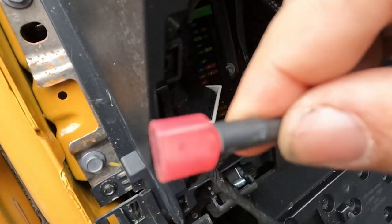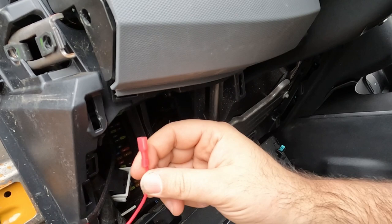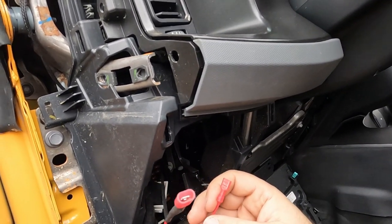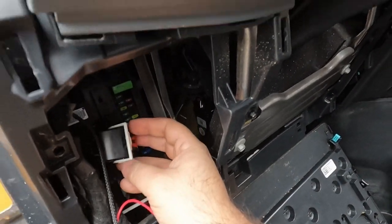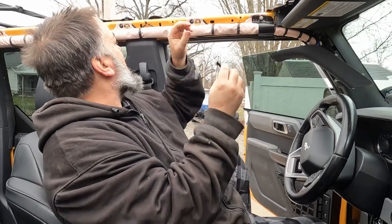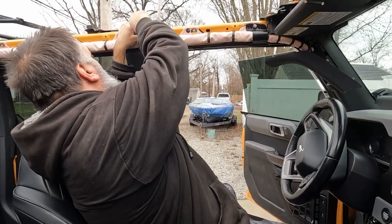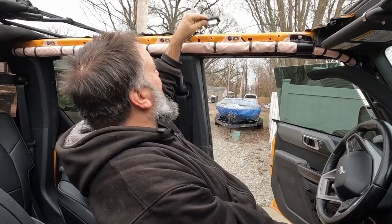The trick is just getting that onto the wire — putting it on that gray wire with a purple stripe and clamping down on it so we can plug into that. Now we've got that on there. We just plug this end right into the end of that, and we should have power going to our lights. We have this other tap if you want to run it to an upfitter switch. For right now I'm just going to plug this in, plug the whole harness back in, and then get to adding the light. Each of these lights has its own little plug and it should just plug in right here — and hey, we got a light on!